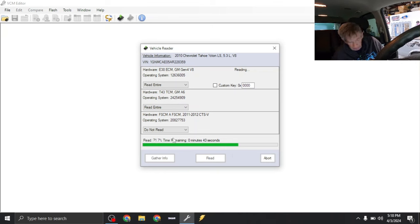Is General Motors pretty good about sharing their stuff on these? Yeah. Sometimes on the giveaway truck and the C8 Corvette, HP Tuners will take a little while to get into it, but once they're in, it's completely fine. I don't think General Motors is happy about us being able to tune the 2019 and newer stuff, but they'll be okay. This Tahoe — this is the one that does the four-cylinder mode, right? Yeah, where it comes up to speed and alternates between 8 and 4 cylinders. They call it displacement on demand, or active fuel management. So we're going to turn off the DOD on this thing, because with this exhaust it just sounds like a bumblebee, and we're going to increase the throttle response.